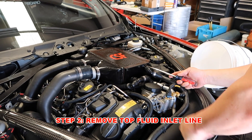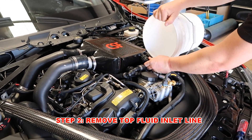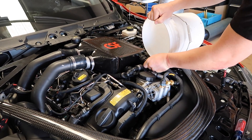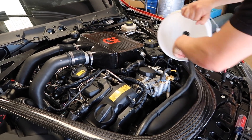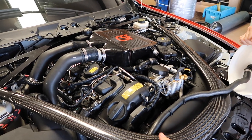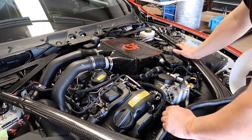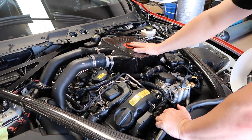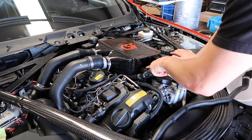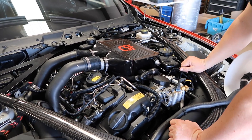Next step, we are going to remove the fluid lines and try to capture as much of the fluid as possible. We run water wetter in our cooling system. We'll wiggle this loose and try to capture as much as we can. Not going to leak too much out of this side because this side goes to the actual cooler itself in the radiator box. There is fluid in this currently — as we start to pull it out, we will leak some. But that's the first connection you want to make. We'll undo this second connection here in a minute once we get the rest of the charge pipe and electrical connection undone.